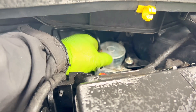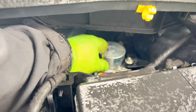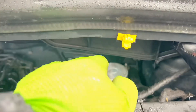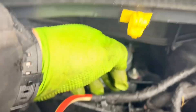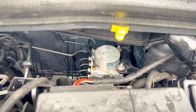We repeat the same process for all the remaining lines to the wheels and the master cylinder. Each one is a painful quarter-turn at a time until fully tightened. Got the bolt in the back, the electrical connector put back on, and the cover back on. Now we're going to move on to the bleeding process.